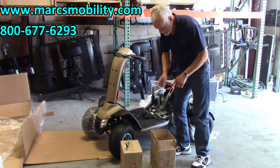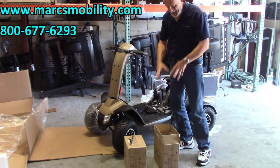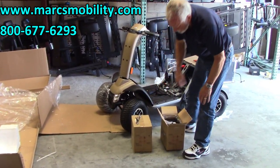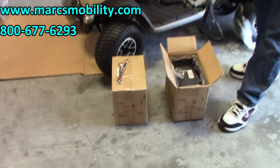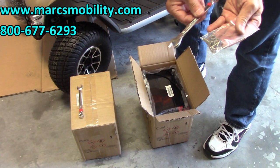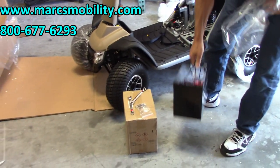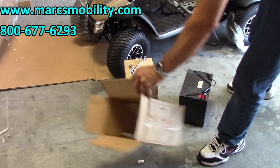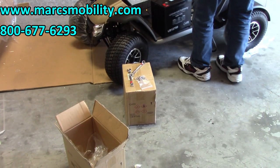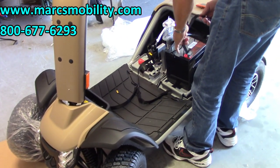We've got the batteries — they were actually outside the door with the scooter but sat outside the building. These are the two batteries you get with this scooter — they are 75 amp batteries. You'll take them out of the box. There are half-inch screws, so you will need a half-inch socket. The batteries are pretty heavy so you're going to need some help. Take the batteries out and there are loops — you're going to want to put the battery inside the loop; these are just straps to keep the batteries from moving.